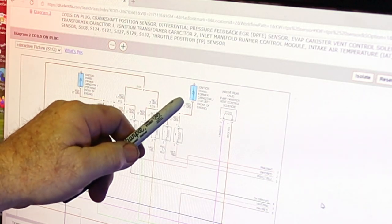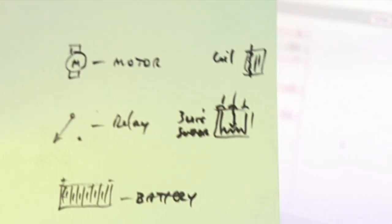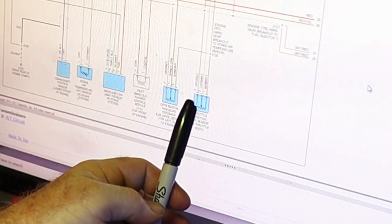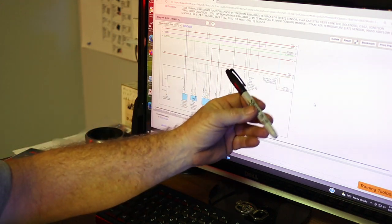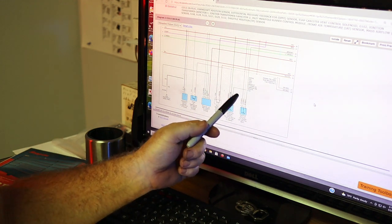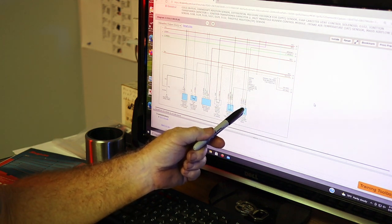There's a variable resistor type sensor — a three-wire sensor. What this symbol is showing you is that there's power and ground, and it changes with movement. As the gas pedal is pushed, or the throttle blade is opened, or the EGR valve moves — every three-wire sensor works the same way. It's going to have 5 volts, 8 volts, or 12 volts — usually 5 to 8 volts. It'll have your 5 to 8 volts, a ground, and then a variable output, which is what the PCM really needs.